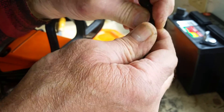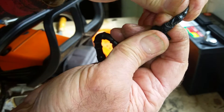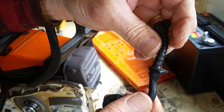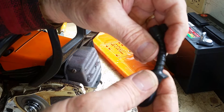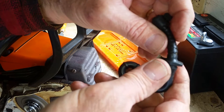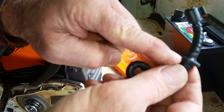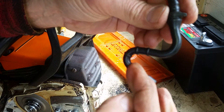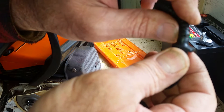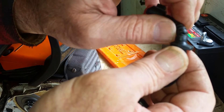Now this one's due too. Stretch that — you can see how big that hole was. So if the engine was hot, what would happen is things expand, because this part is out of the fuel tank. This is all below the fuel tank; this part is above the fuel tank. It starts sucking air right there and leaning out.